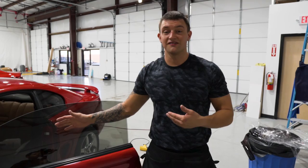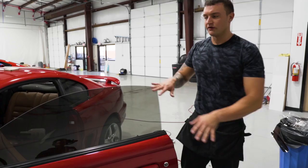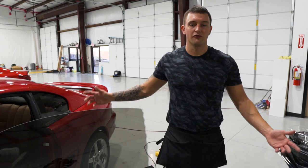Alright guys, that's how you tint the 1996 Ford Mustang Coupe. Last thing you're going to want to do is look over the frameless door windows, make sure nothing popped up across the bottom or around the edge. Make sure everything's laying down nice because it does rub on the gaskets when you open and close the door — they do not shift on this car, but they do rub on the gaskets. And of course, just go over the back window, make sure nothing popped up before you let the car leave. I'll see you guys in the next video.